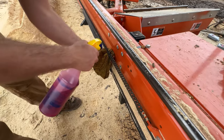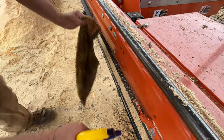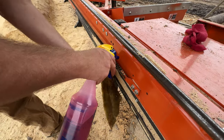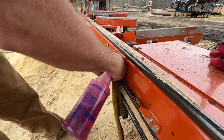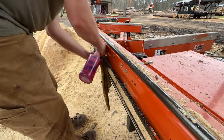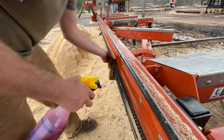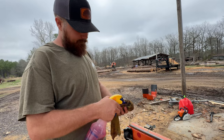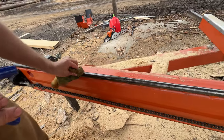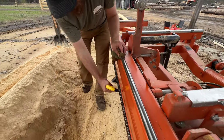Same scenario, different chain — we've got to get through here and make sure we lubricate this chain all the way down. It's a little tight in here where the little pad is; this pad is where it connects to your electronics, so you can only use the electronics when your head is all the way back in the backwards position. What this does is prevent rust, kinking, and binding — that's the reason for it. Then we've got to take care of this rub rail. My rag from going through all these chains is really oiled up, so I'm going to take it and wipe the top of this rail off — keep it clean and lubricated. There's a bottom rail too — same thing.